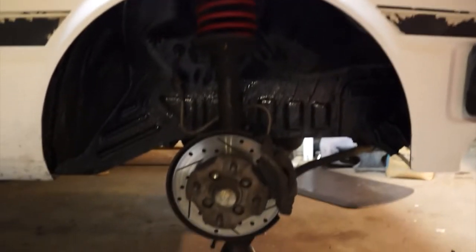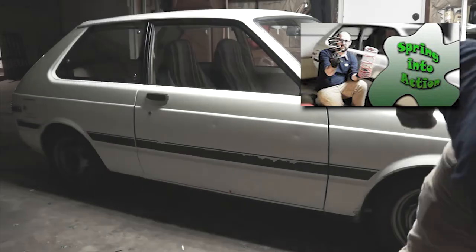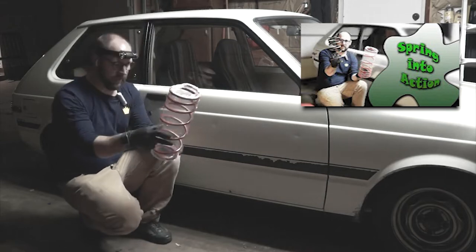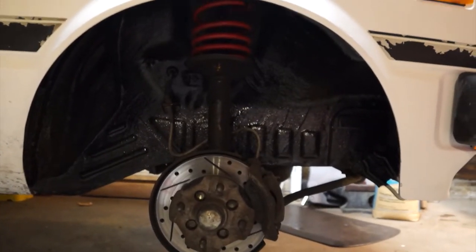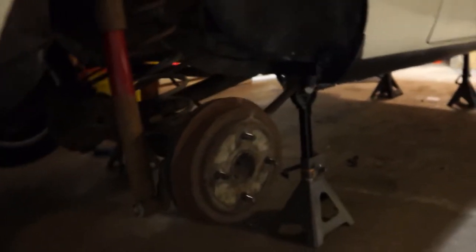So currently on the Starlet, we have what were AE86 lowering springs that I ended up cutting down. In an earlier video, you saw me put those in full size. These are cheap eBay AE86 lowering springs, so we've got to pull this whole strut assembly out on both sides and completely disassemble it. We're going to keep the spindle. The back end is going to be much more simple and straightforward — just unbolt the shock absorber from the bottom and then from the top. That spring is one of the stock springs that is also cut.